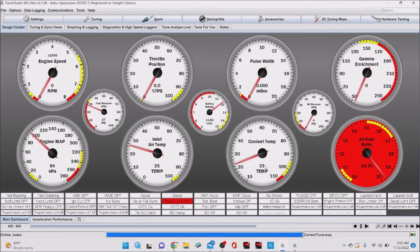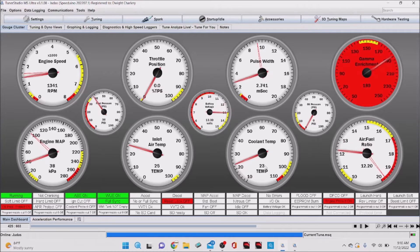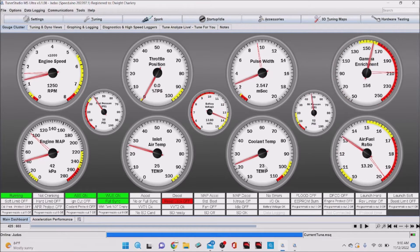I'm going to go ahead and crank the car to show you that it starts perfectly without any throttle input and without an idle control valve. My battery may be a bit low, but let's see how it gets on. It's at 1300 RPM roughly, which is okay for a cold start. The after-start enrichment goes off and my AFR is around 13.4.